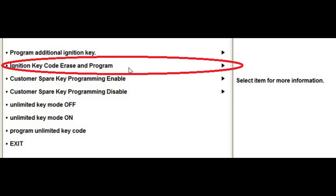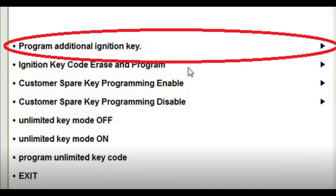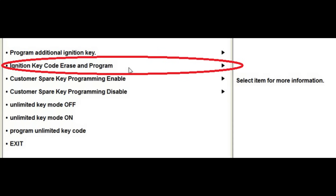This vehicle may not run when you're done, so if you've got to get it out of your bay or get it done before the end of the day, just understand you should have a strategy to get a second key. Now, if the PCM you're replacing is used, many times if you only have one key, you can get away with only adding a key when you get to the menu. Do not erase the keys if you only have one key or you'll be dead in the water. A lot of times you can get away with just adding the key. If that does not work, you're going to have to go back in, do the 10-minute procedure again, and do the key code erase and program. Many times it does work though.